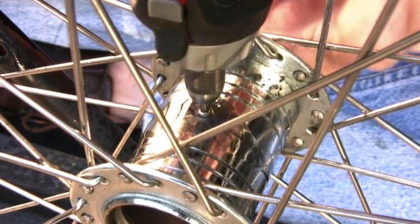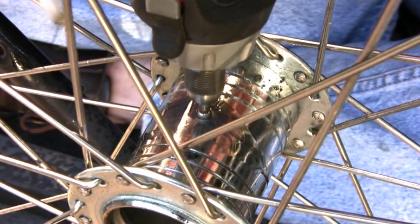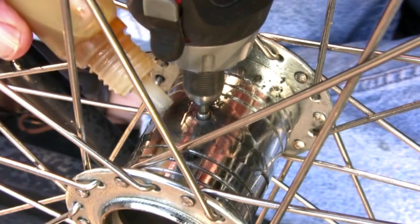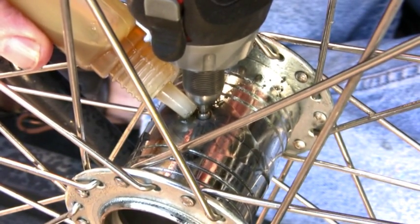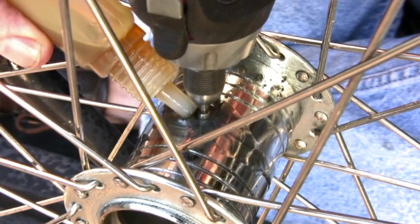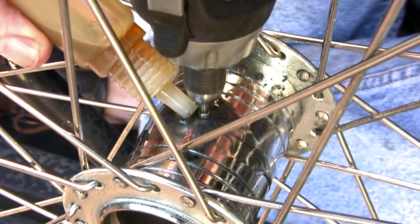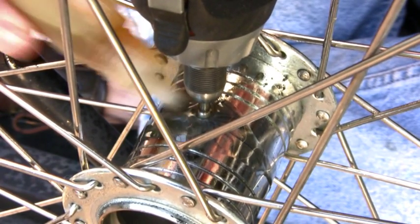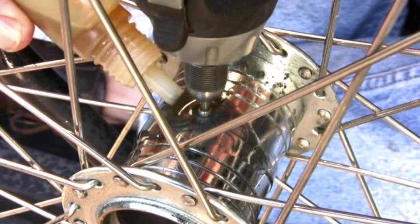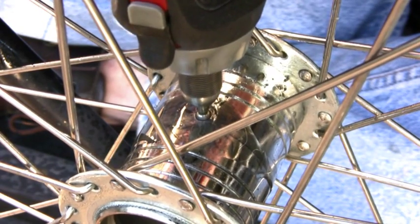Well, 3/16 anyway. I'm gonna get through it, enlarge the hole, grind some of the threads off of the Zerk fitting, and make it a tap-in fit using some sealant like JB Weld epoxy, because I certainly will not be able to tap threads into this hardened, super hardened steel. See the gray stuff wash away? I am making progress, but man, is it slow.